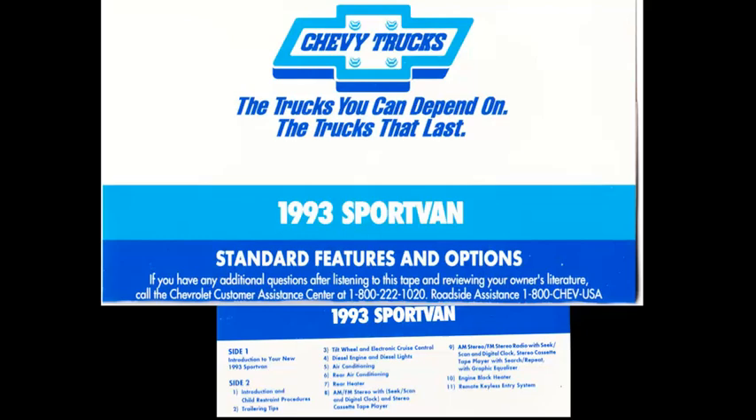The headlights, taillights, and side marker lights are operated by a three-position switch on the left of the instrument cluster. Pulling this knob out to the first position will engage your parking lights, taillights, instrument panel, and side marker lights. Pulling it out all the way engages your headlights. By rotating this knob, you can control the light intensity of your instrument panel lights when the parking or headlights are illuminated. Rotating the knob fully counter-clockwise will turn on the interior lights.